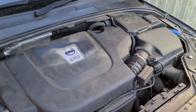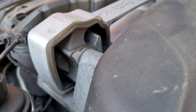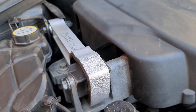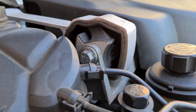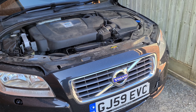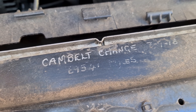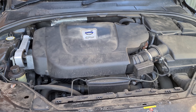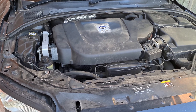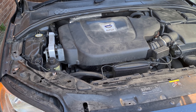In terms of items that could break in the engine bay, the first one I replaced straight away was the upper engine torque mount — about £30 from eBay, literally bolt-in bolt-out. The bushings perish and cause issues, so get that done as soon as you get the car if it hasn't been done already. Apart from that these engines are absolutely solid, but make sure the cam belt has been done — it should be done every 60,000 to 70,000 miles. If it snaps it will grenade the engine. Also make sure the water pump was replaced at the same time, as you don't want someone who has cheaped out on maintenance.